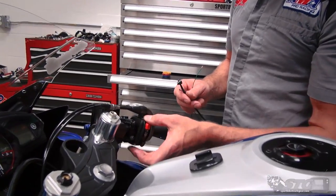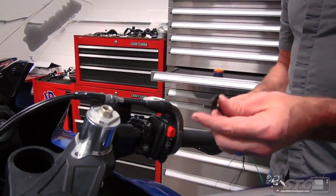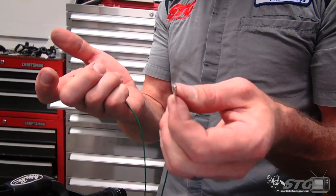This is a full race bike now. He's going to go racing next year, doing sport bike track days this year. Built into this start-stop switch is the brake light switch wiring. The OEM master - I've removed the brake light switch from it. What I chose to do was back the terminal ends out of the connector - both green wires, easy to identify. Once again, the cam that works best for track day riding or road racing is going to be that progressive cam, the orange colored one, right between the 45 and 50.